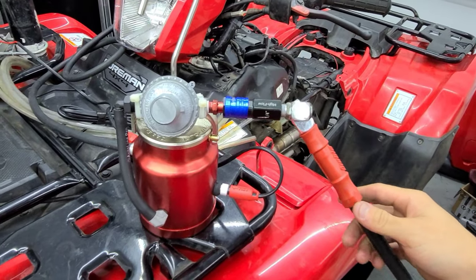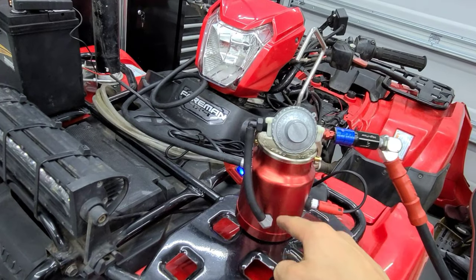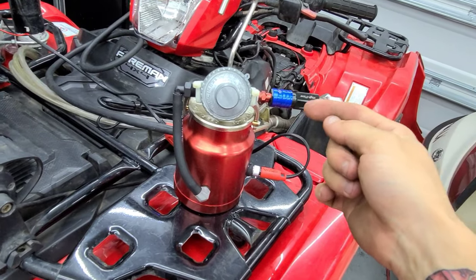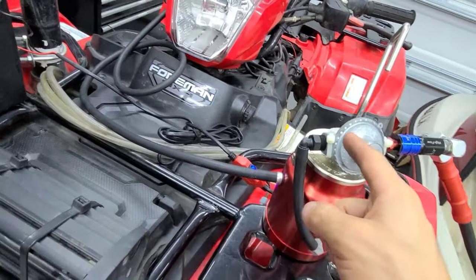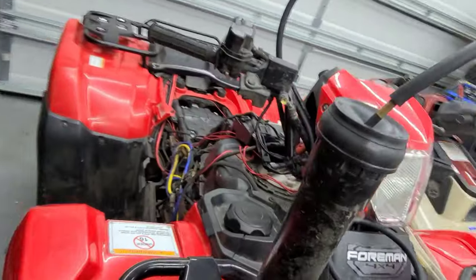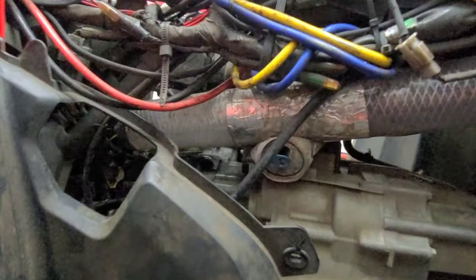It's going to provide pressure. This is going to regulate how much smoke and air goes through, so I don't have to worry about how much PSI is going in through here, because it doesn't matter. This is going to regulate it. So I go ahead and I let that pump it through. It's clearly pumping a lot of smoke in there, and let's look around and let's see if we can find where it's leaking from. And if there's any type of leaks, you'll see it.